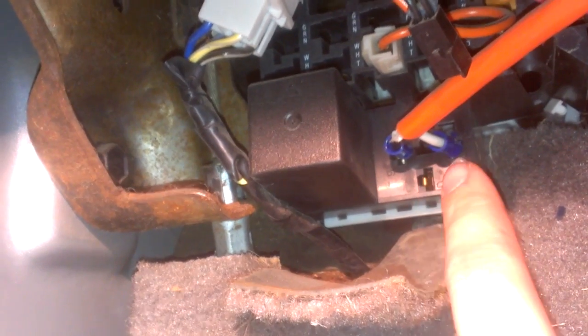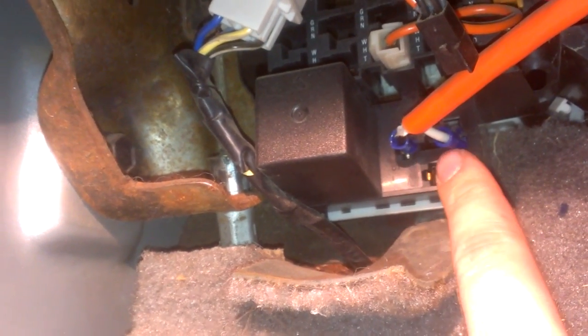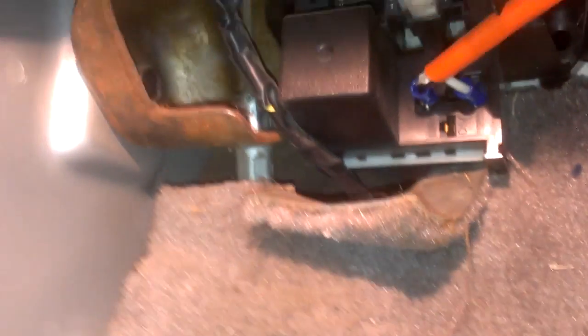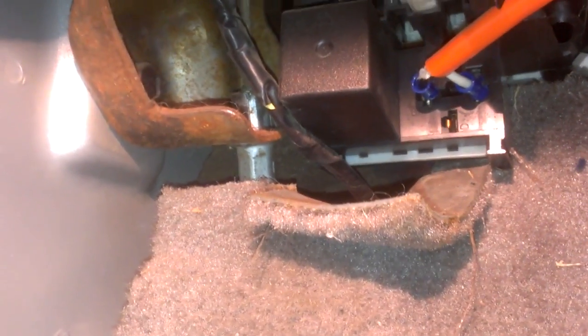My relay used to slide in right here. I've got what I believe is a ground and a positive — when I hit my horn it goes through the actual horn button and comes back out here. I've got a separate relay just taped up here in the wiring. When you hit the horn button it opens this relay, and I have 120 volts running to the contacts on that relay. The actual magnet is powered with the 12 volts from the vehicle.